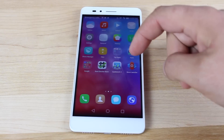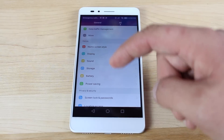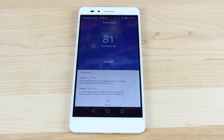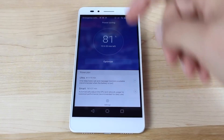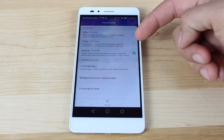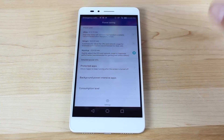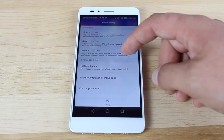There is a battery performance setting that we can just turn off completely — that helps. We'll go to power savings. These settings were made to save on battery life and make your battery last longer, and the Honor 5X has incredible battery life, but it doesn't really need all these intense measures. So what you can do is turn on normal mode. It's set at smart mode by default when you first power up the phone, and you only get about an hour of battery life savings from it anyway.